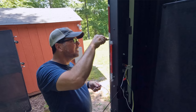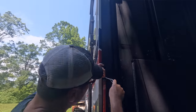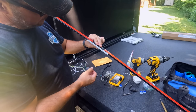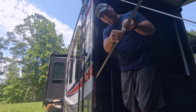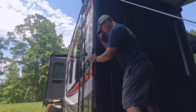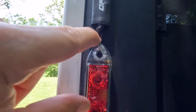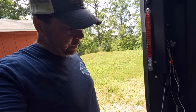Once I was satisfied that the adapter worked, I went about physically mounting the light bar so I could then tackle the wiring. I just used a metal drill bit to drill a pilot hole, and then I used a step bit to widen the hole just enough to fit the light bar wires in. The light bar kit conveniently comes with a plastic piece that holds the two ends in alignment while mounting it, but it doesn't snap on so you have to hold that piece right there. It's centered for gravity and weight anyway, so holding it there I was able to peel off the backing on the bottom and top sections and carefully lay them down. I always put these things on very lightly until I have a chance to back up and look at them, then push them down more firmly. Now it is physically mounted, and all I need is a little bit of black silicone sealant right in the wire entry hole.